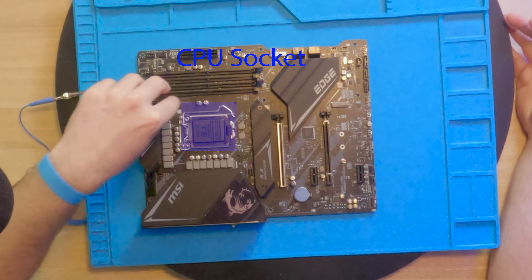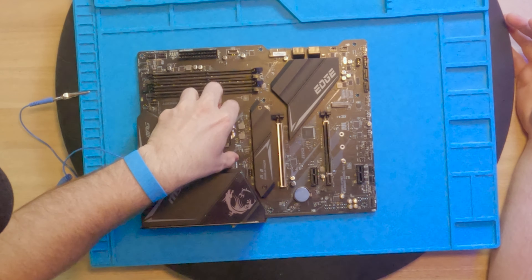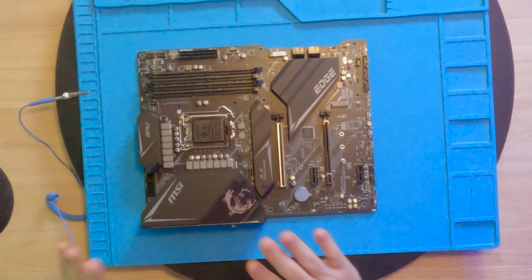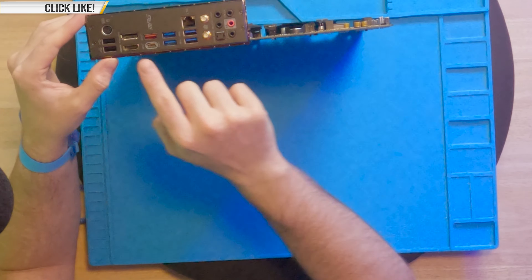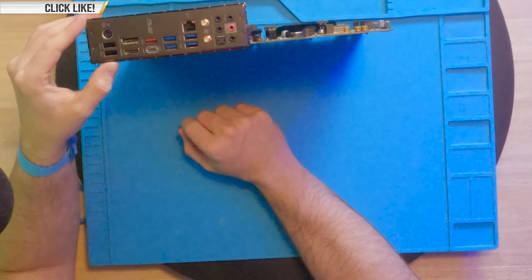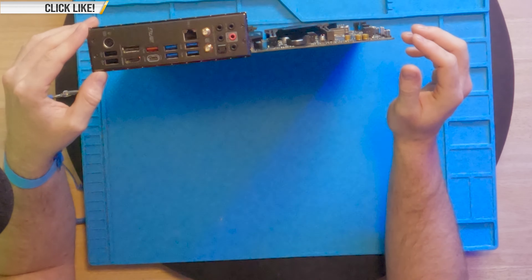Right here I'm noting four lights that will help indicate errors — that's very important. Coming across the top we have four DIMM slots, and when we install the RAM we need to follow the guideline right here. This explains that this channel and this channel are the primary channels — we want to set our RAM there, as that's what the system expects. That's how you get the best performance from your RAM set.